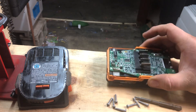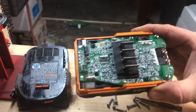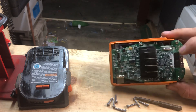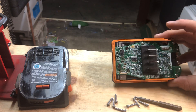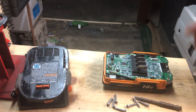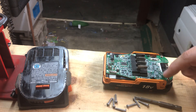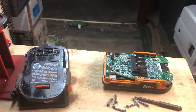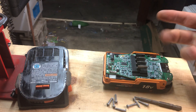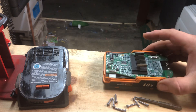Unfortunately I had to clean this kind of hot. There are six Phillips screws on this board — four black ones and two silver ones. Even if you take them off, you still run into a problem because there are six lugs soldered into the battery pack. I think the board gets screwed down and then wave-soldered in. Regardless, I could not pry the board up with all those screws out, so you can try it — maybe you'll have more success than me.